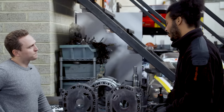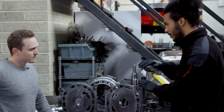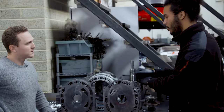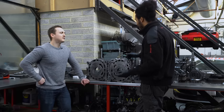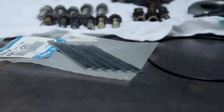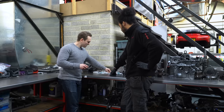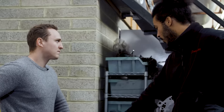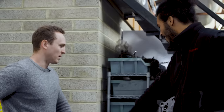It all depends on what you've got bolted onto the car. For a stock car with street ports, there's a nice noticeable increase in the later stages of the rev range — focus is mainly on the mid range to the top of the range. For a bridge port, it's basically an extra port for the intake and that allows even more air to come in, aiding the engine in terms of breathing well past 7,000 RPM. Here we've got Apex Seals laid out — brand new, genuine Mazda ones, which are the only ones we recommend. If it was a bridge port, we'd have to change them to something like a goopy Apex Seal, just because the corner piece has a bit more height to prevent it from falling into the port.